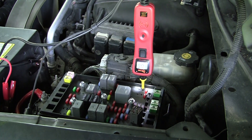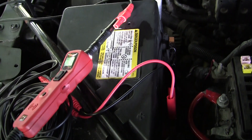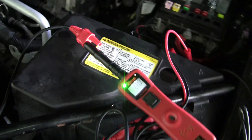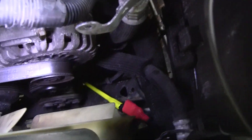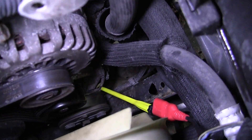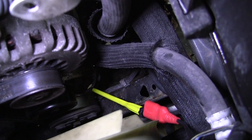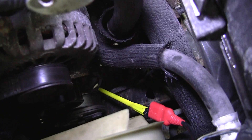I've put together some parts with the power probe and a battery, then got the power probe actual probe going to an extension cord down to a wire piercing probe. I've got it on the red wire right on the compressor clutch, and when I feed it 12 volts I get no response.